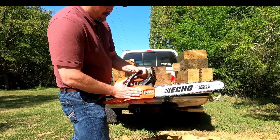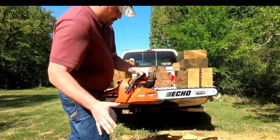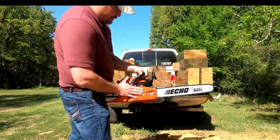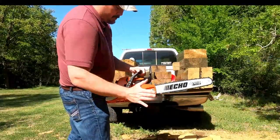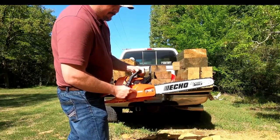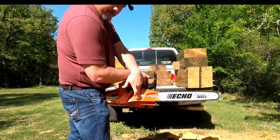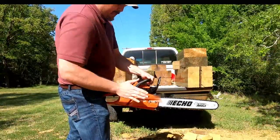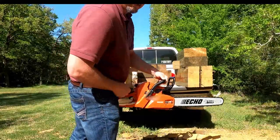Let's talk about what we're about to see. This is one of my Stage 3R ported saws — basic muffler mod, not very loud — and it has the highest RPM potential of any saw I've set up. It's got a factory full-chisel chain, factory bar, and the sprocket upgrade with the 7-pin. We're doing some test cuts, then swapping to the 8-pin and testing again with no other changes. The saw was warmed up, which is also why it fires up so easily.